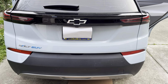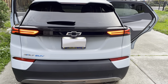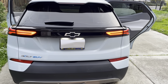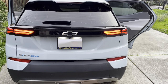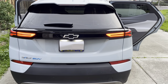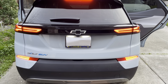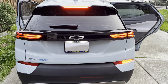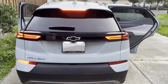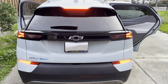The wiring is now all done — time to check functionality. With daylight running light on, the tail lights on the tailgate do not change intensity while the two side lights are dimmed. Daylight running light on with left turn signal, with right turn signal, with brake on and left turn signal, with brake on and right turn signal. Daylight running light off with brake on, and daylight running light off with brake on and left turn signal.